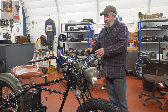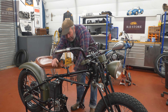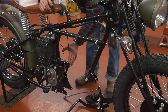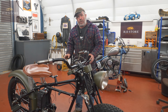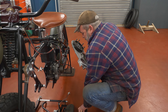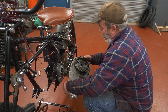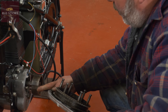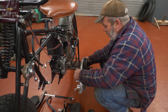You have to put the engine in first with the engine plates, but only on one side, then you can fit the engine in. So you just put this plate on and this plate on, fit the engine in, then put your other plates on. The gearbox has already been built, so then you have to put your primary on because you have to bolt the primary to the gearbox through holes in the clutch basket. That's your inner primary cover. Once your engine's in, the drive sprocket comes through there and slides on. You've got three holes — that's four bolts around there — so that gets a gasket and then you put that on to the engine and the gearbox.